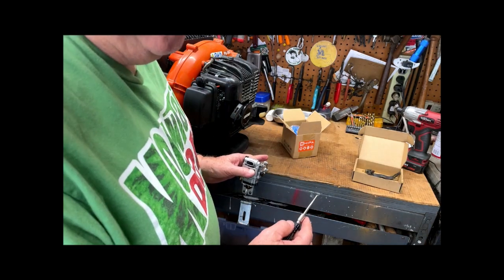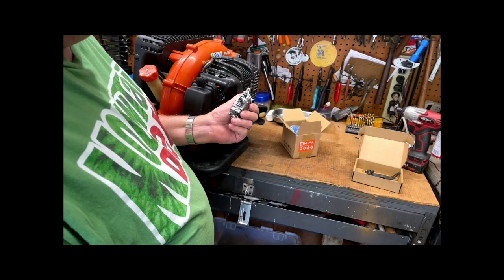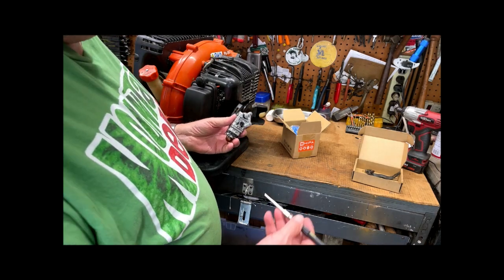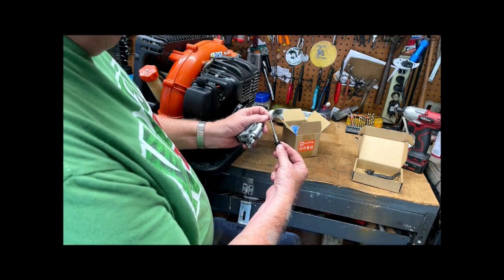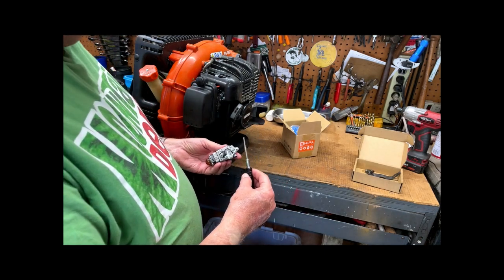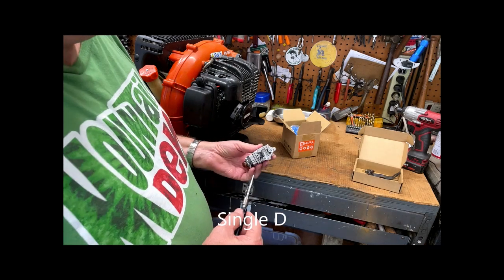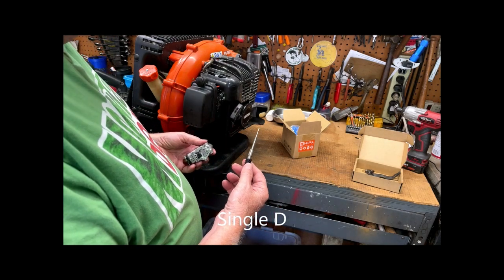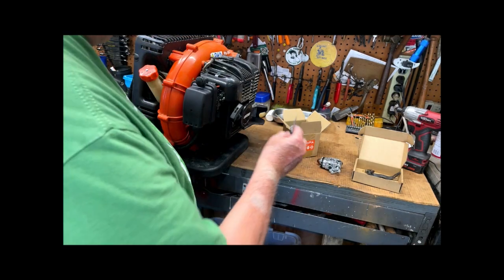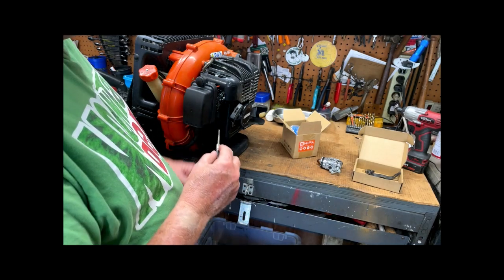The first two carburetors are designed with the tiniest little jet openings here, basically unadjustable. But you can buy a special tool that's got a micro head on it, I think a micro D head, mini D, micro D. And it's supposed to fit into these little holes where you can adjust the jets on it. Well, this is the tool I bought. It won't go into the OEM carb at all, but it did go in the Hipa, and it did go in the first OEM carb.